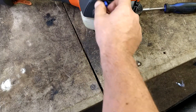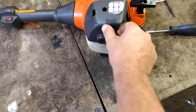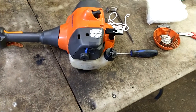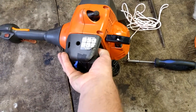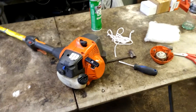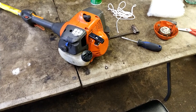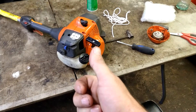This one doesn't run. You can see the customer had a custom choke holder thing because it was stopping running properly. It's priming now — I might be able to adjust this. I'm not going to pull it a hundred times. It needs a new carburetor, it's shot.